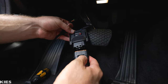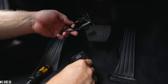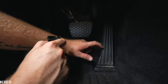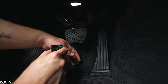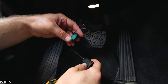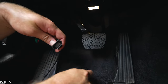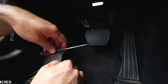Before we get started, let me give you a rough overview of what's going to happen. The main control unit is going to clip in like this, and you really just have these two plugs. There's a T30 under this little black plug — we're going to pull that out. The entire pedal is then going to come out, and there's a plug that goes from the car to the pedal. We'll replace one of those plugs, route the wires up and out of the way, and that is how easy the install is. Grab your pick tool and let's get started.